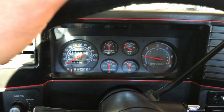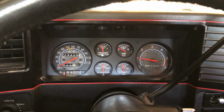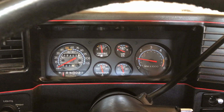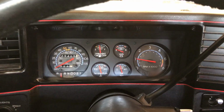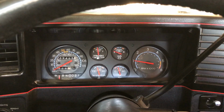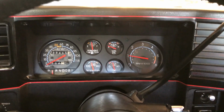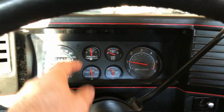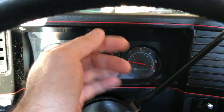that is really just more as a follow-up to the LED light bulb replacement that I did in a previous video. And I'll link this video as far as the removal procedure to get at the third sub bezel and subsequently the lighting. But again, just note that this procedure you can stop at the second sub bezel, this window sub bezel, and then there's just 2 screws for the tach, and you can pull that out.